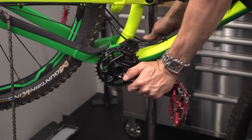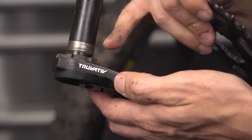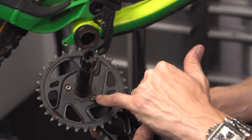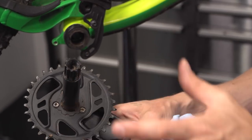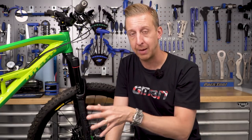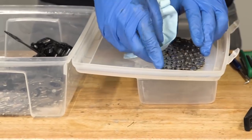If it's the cranks, check the 8mm bolt that holds them on and check the interface where the cranks and axle mate. Also check the bottom bracket and the spider where it attaches to the crank. If your bike has conventional chain rings, check each and every one of those chain ring bolts — they are notorious for creaking. Your chain doesn't tend to creak; if there's a problem with a chain it typically just snaps. Keep it lubricated and check it doesn't have any damaged links, because when outer links come away from the pins, the load under pedalling torque can't be handled and they pop open and snap — something you definitely don't want when riding.